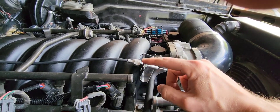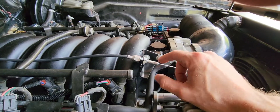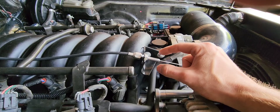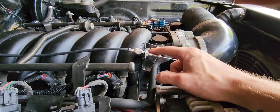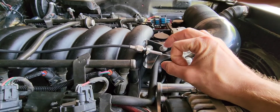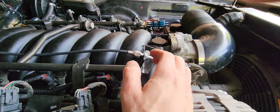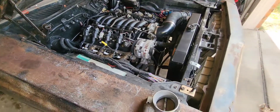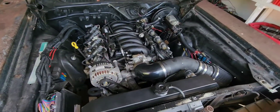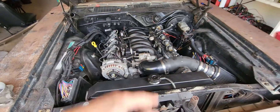Or, if you don't want to bend it because you don't want it to look funky, you could take out one of these bolts and slide the whole bracket forward so it's just sitting with one hole mounted here. Or make the two mounting holes bigger so you can slide the bracket over — that way you have both holes mounted but just scooted forward. I'll probably just go with the easiest option which would be tap-tap-tap to bend it forward, or move the bracket over one hole with just one bolt.